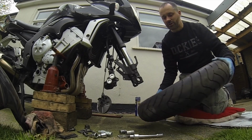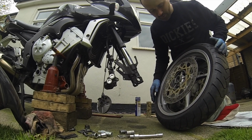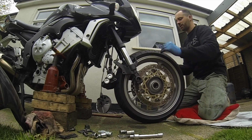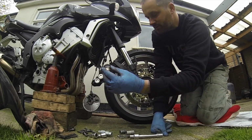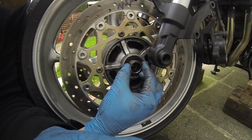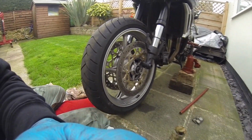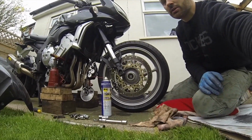Don't lean it straight down on the floor where you sit it on a disc, as you don't want anything to break or warp. So lean it against something or put it down on something. We need to just bring it into place, and there you can rest it against something there. You get your bush from the outside. It's a spacer, so all it does is sit just inside there like that. That side, the disc's looking quite fancy, quite smart. Looking forward to getting it out on the road the first time in 2018.